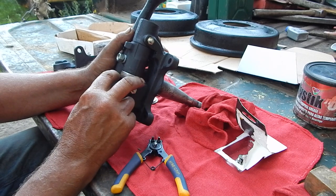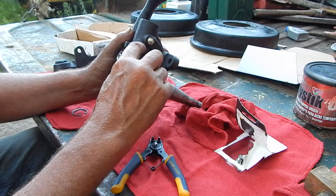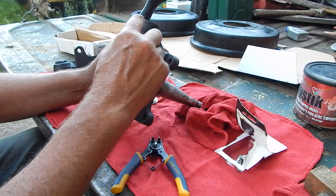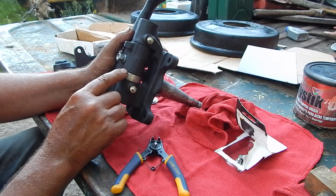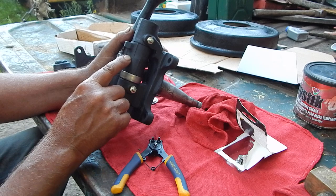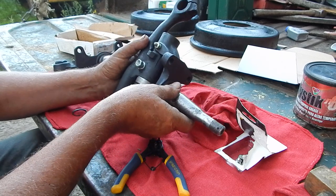Got that out of there, then we were able to move this piece down far enough to get the wheel in there and cut between here, and then the two ends fell out. But even then we were just dealing with the shaft being stuck in a short piece — it took a 20-ton press and a lot of heat to get it to budge, and then she'd come out boom, but it wasn't happy to do it.